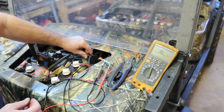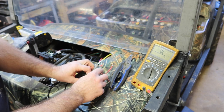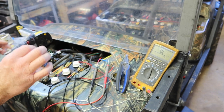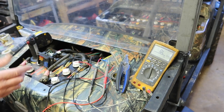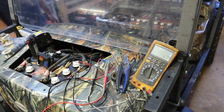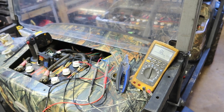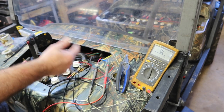Remember, we've got it connected to power with the key switch. We've got the ground constant. Take the yellow wire out of the equation. I've got an ohm meter set on ohms. If I touch the two together, I should get a low reading. So right now, red and blue are not connected. So if I turn on the key, that should go to energized relay and those two should connect. There we go, those two are connected. Let me turn the key off. There we go. So we've proven that the red and the blue are what we need to connect,